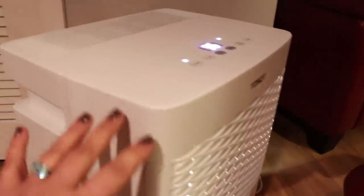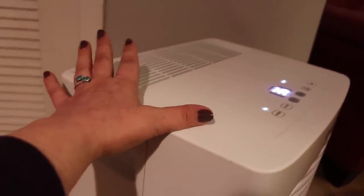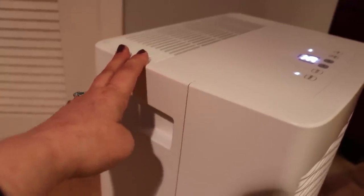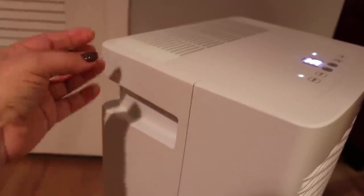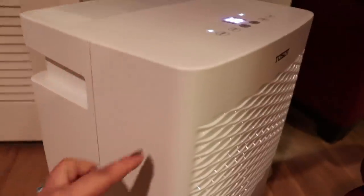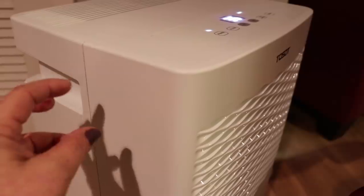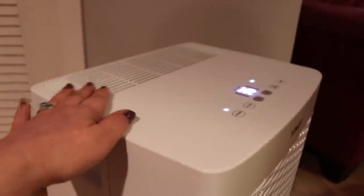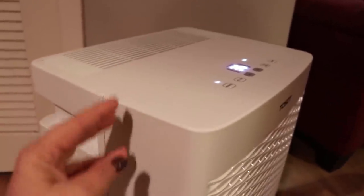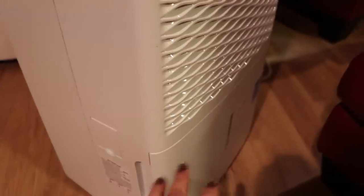You will see that the air ejected from the back is hot air. And at the beginning of using your air conditioner you see a lot of condensation and water dripping from it. This works pretty much the same way — the air comes in, gets circulated around those coils, and then the air is heated up and comes out the other side. During that process, the moisture from the air is captured and goes into a tank at the bottom.